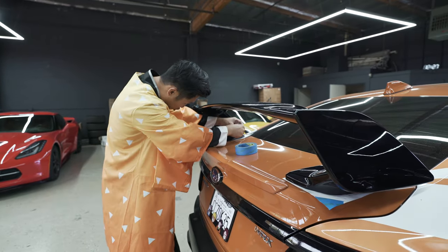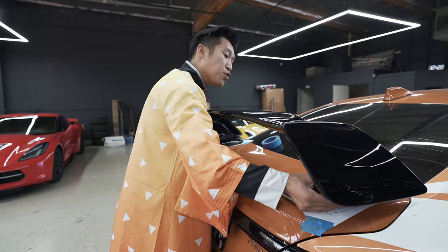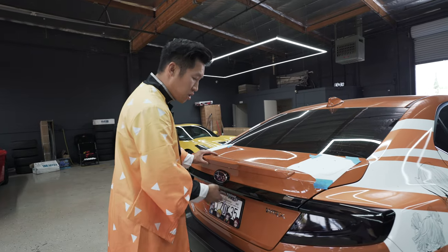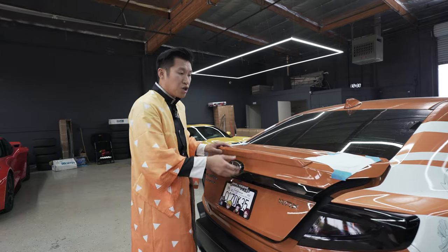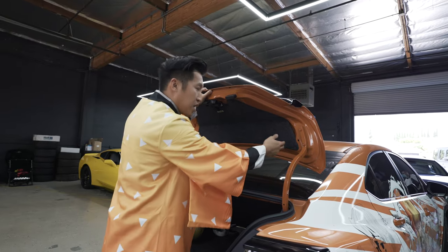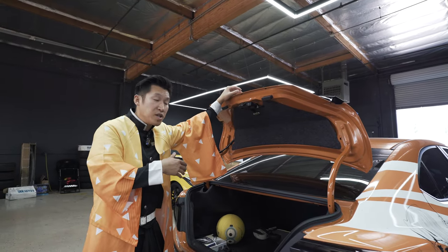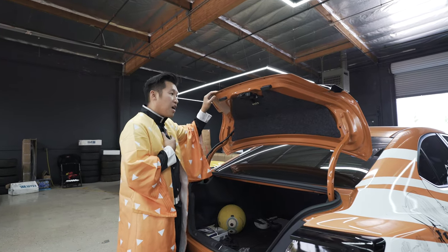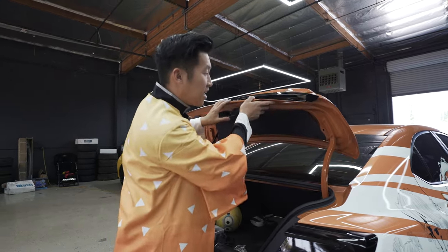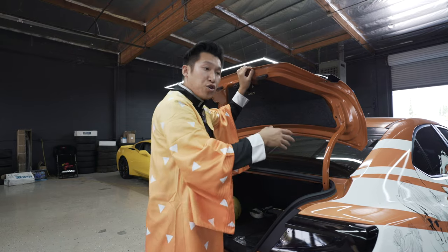Tape down the corners of the template so it stays in position after you remove the spoiler. Once the template is taped down, remove the spoiler. On the template, those are the holes you need to drill out — you'll know where to drill. Then look underneath and visualize where the hole is going to go through, because you don't want to drill through a spot and puncture a wire. In the wing install process, you are going to have to take off the trunk, because where that corner hole is, it actually comes out behind the mounting bracket. That's why you have to take off the trunk in order to install the spoiler properly.